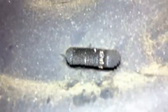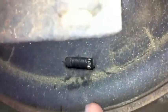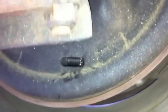There's a great view of what it looks like inside your brake drum, and that's the adjuster for your rear brakes. So I rotated it about 3 clicks, and now turn it, Carlos. You hear that? That's actually the brake pads just barely touching. Now I'm going to do the same thing on the other side, and we should be good to go.